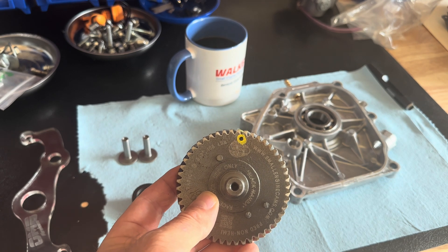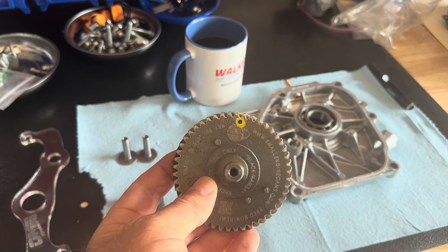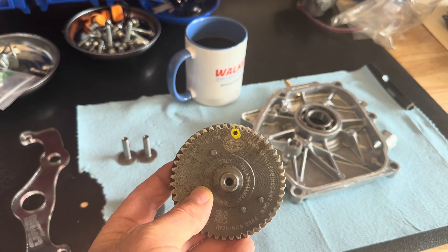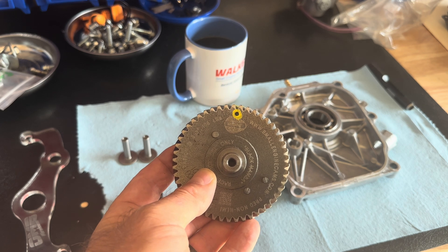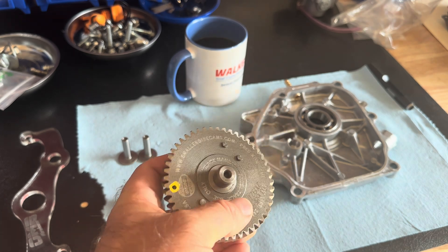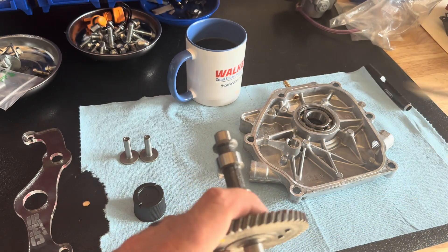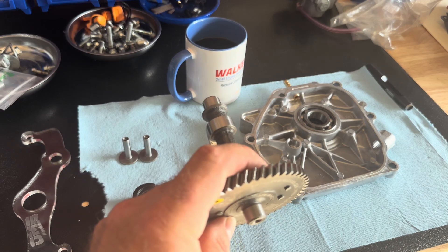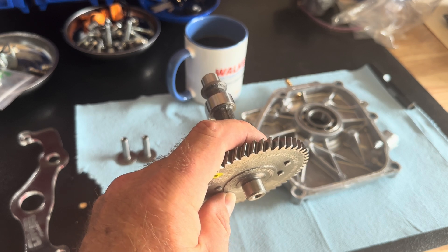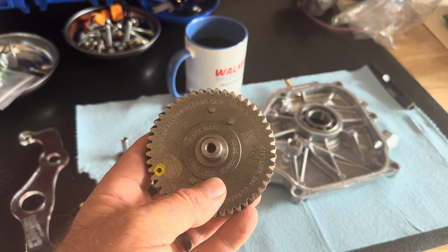One of the critical things when installing a cam is getting it timed right. I've seen people mess this up — I've even messed it up on big expensive automotive engines, embarrassing as that is. This is our timing mark, and it's going to correspond to the timing mark on the crankshaft. Remember, this is a Predator, so we have to order the Predator non-hemi cam — the cam journal sizes are a little different from Honda clones, Predator Hemi, Predator Ghost, Predator 224, Tillotson, Ducar, Wildcat, and pretty much everything else.